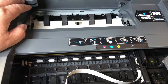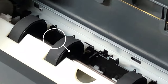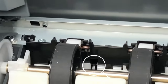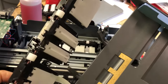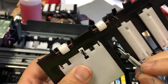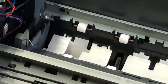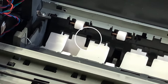Now we can move on to the two sensors in the back. The first sensor is the tray sensor. It's very hard to find — it's on the left. Just pull out and insert your paper tray and pay attention, you're going to see it. The paper tray will push this lever inside, and then mechanically the force transfers to the left, and a small lever will go outside. Check if you push the tray in, does the lever go forward?